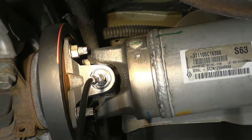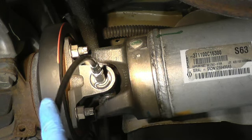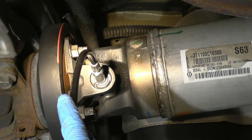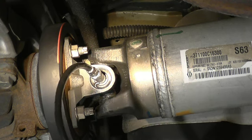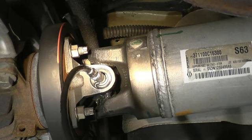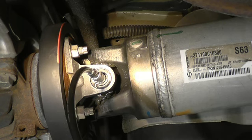So there's the drive shaft and there is your grease fitting. Touch the grease gun hose to it, attach it, twist it, make sure it's secure and locked, and now start pumping the grease in. The grease should be coming out from where the joint connects to the drive shaft. What you want to do is keep pumping until a lot of material is coming out — you want to flush out any moisture and any old grease. That's how you do it.